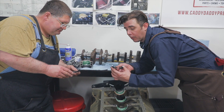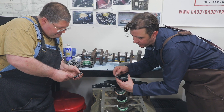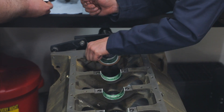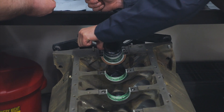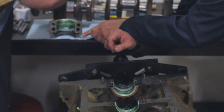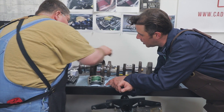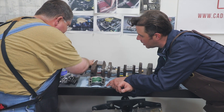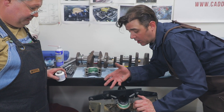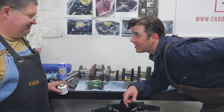Before we can put our crankshaft in we have to put our rear main seal in. There are two pieces — one side is a little fatter than the other; the fatter side goes to the rear of the block, to the outside. You want to push these in by the ends — don't push too hard in the middle and deform anything. The seal needs to be lubricated, so I'm going to apply some oil to the sealing area of the crank because you don't want that seal to run dry when you first start the engine or you'll burn it right up — just a little lubrication so it's fine until the oil is splashing around after initial break-in.